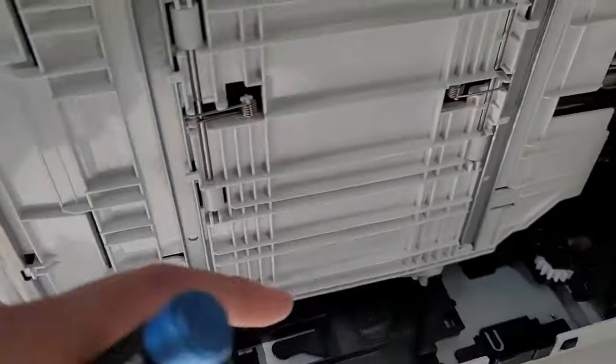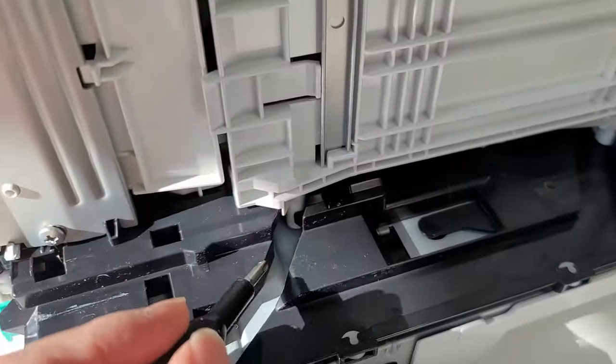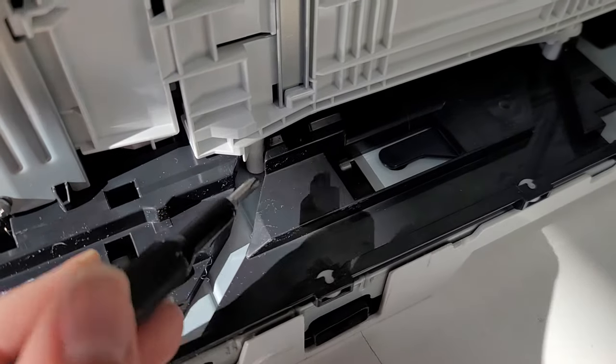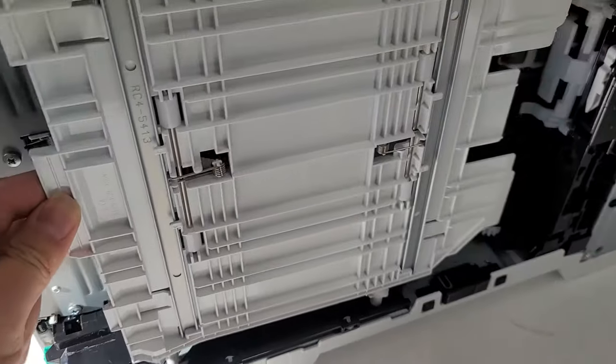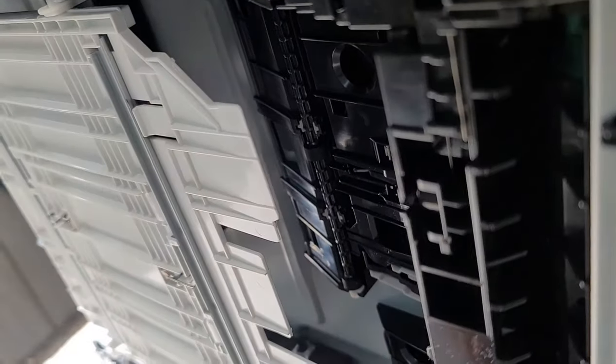This piece here had paper trapped under it. Down on this edge there's a little spring-loaded piece — you can push that down. Once you push that down, you can actually pull this whole tray back, and assuming the paper jam is in this piece, you can get access to the paper jam.